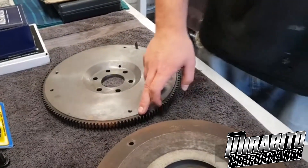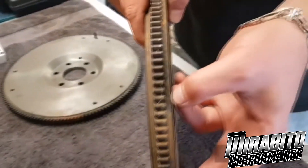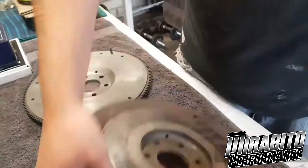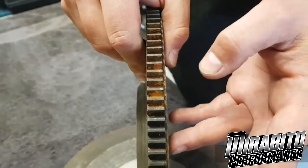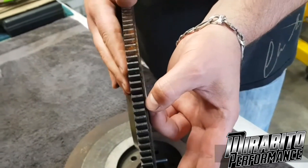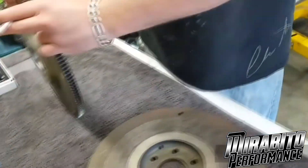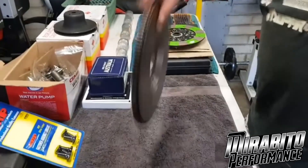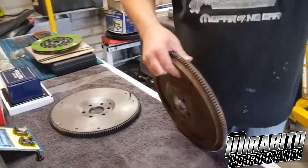The other thing — it's been machined across it. But also look at the stock one — see the thickness of all that? That's all weight. On this one I've knocked the thickness down in half. Sometimes I go right up to the ring gear and just go straight down, so basically the whole flywheel is as thick as the ring gear — just that thick all the way down. Put the angle on it and you can get them down to about six kilos. This modified one definitely feels lighter — that stock one is more of a dead weight.